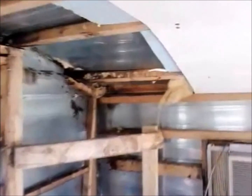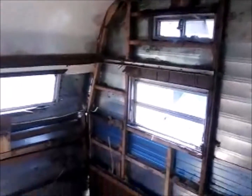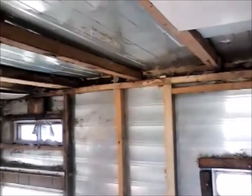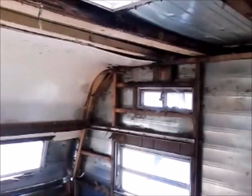I've never done a remodel of something this small in these close quarters. Now there's a guy on here — he's got a name that sounds like RC Jets or something — it's called the Ultimate Camper Rebuild. He just used 2x4s to rebuild his, and I can see why, because they're probably the most durable thing you can use. So I'm going to start with some paneling and some 2x4s and a hell of a lot of spray foam too. I'm definitely going to have to get some mold cover-up and probably some latex paint to seal this up, because not everything I'll be able to take out without ruining the structural integrity and having to reskin the entire wall. But for the most part, I do believe I can chisel out the worst of the rot and replace it with some 2x4s and a bit of 2x6s.